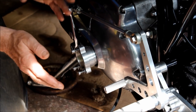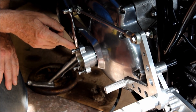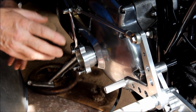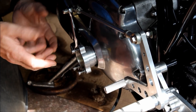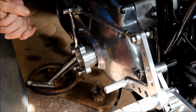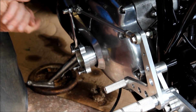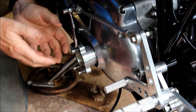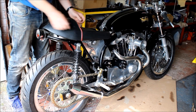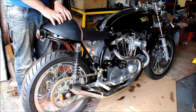There is one more reason I can't try to start the bike just yet — I don't have a working clutch. The slave cylinder here was leaking like a sieve. I bled the system several times and each time I came back it felt very loose with air in the system. I took it off and sure enough it was leaking really badly. I've ordered a rebuild kit for that slave cylinder — the part is from a Honda Blackbird. When it arrives I can rebuild the slave cylinder, bleed the system, and hopefully have a working clutch.